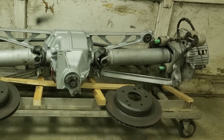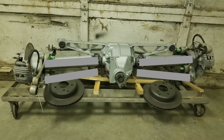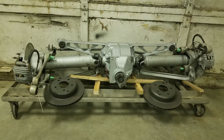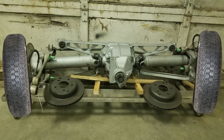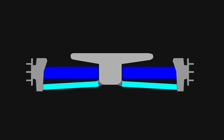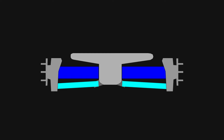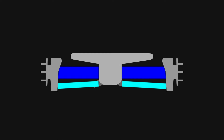This is not a short, long arm suspension. Both the axles and control arms are about the same length, but the camber curves are dictated by the distances being different here and here. This causes the wheel to gain some negative camber on up travel and lose a bit on droop. As you might imagine, shortening both effective arms equally will increase the amount of camber gain and loss, but this will actually work to our advantage in keeping the tires inside the fender lips through maximum bump.